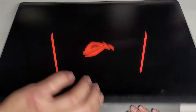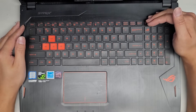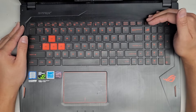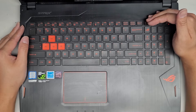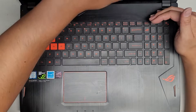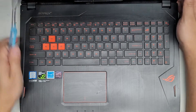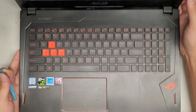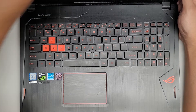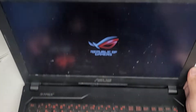Flip this over — we'll see if it powers up. I saw the power light — it just flashed once. It's turning on. Solid red light. Sometimes when you disconnect the batteries it does a weird BIOS reset thing. It's powering up now. I was a little bit worried that sometimes when you pull the RAM out you need to reseat it and it doesn't go in right the first time, but it looks like it's good.